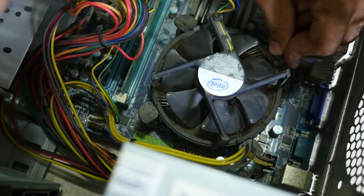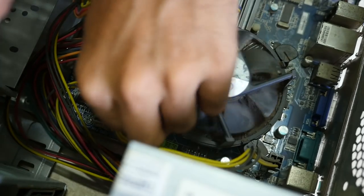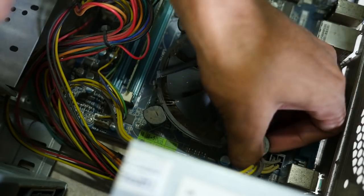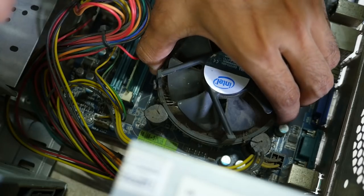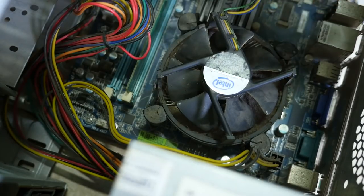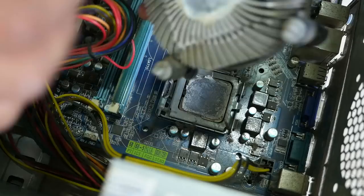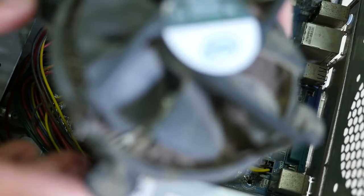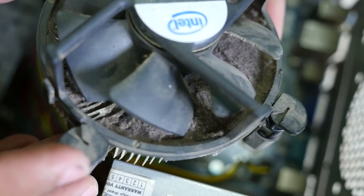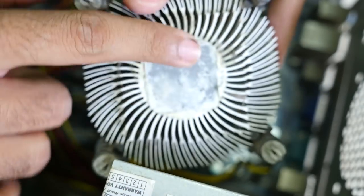Now it's time to remove the CPU cooler, which is most damaged by dust. In my opinion the fan is the reason why this PC is not starting at all. The stock Intel cooler has arrows marked on it which makes it easy to remove, and removing it is far easier than putting it back. This is the thermal paste which has become a totally solid material after years of usage. As you can see the CPU fan has so much dust inside it — I was totally surprised by the amount of dust present in this fan, and no wonder the PC was not starting.